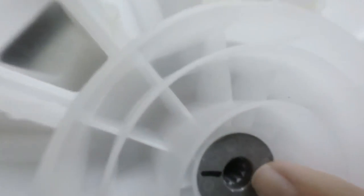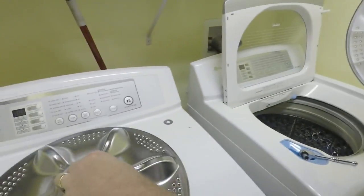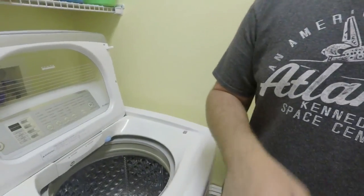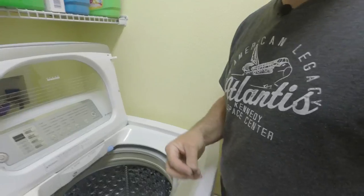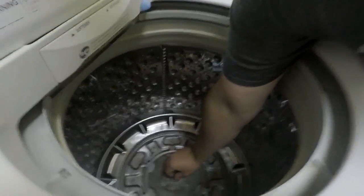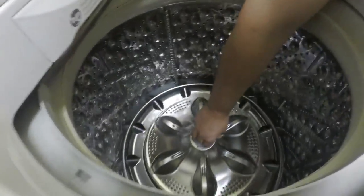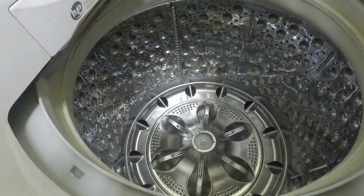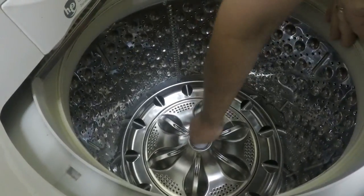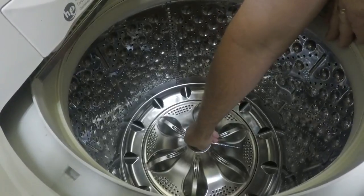Pretty simple fix. Don't forget your washer — that goes on first. I would also highly recommend cleaning the crud, which we've already done. Put your thrust washer back on, then put the new pulsator in. The pulsator we got came with the bolt. We'll put links and all that in the comments, of course.